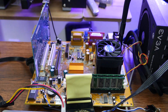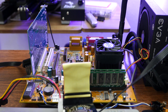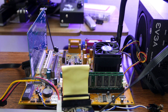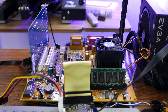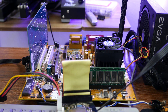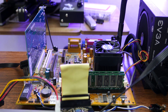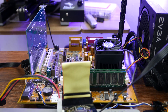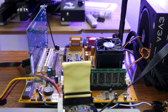My final thoughts on this board: I really dig it, I really like it. It is a weird board, and its only real downside is the AGP 8X compatibility issue, which I think is just a chipset issue. I've got a secret side project using a SIS 735, and that works just fine with AGP 8X cards. So I think it's just a chipset bug they fixed in a later chipset. But also, it's an SDRAM board, the BIOS is from 2001, it only supports Palomino — there's definitely a performance ceiling here. I think AGP 4X really fits well with it and suits the board nicely.